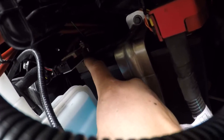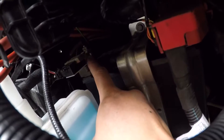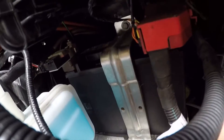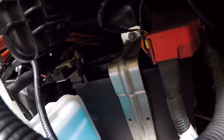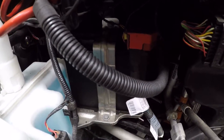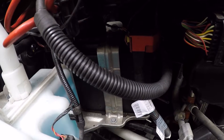The two terminals — negative on the left, positive on the driver's side — look fairly big but it's actually just a 10 millimeter bolt on top. You'll see it once you make some room and take the battery out. You'll also need torx bits to remove the actual terminal piece, which is where the top clamps mount onto — you need to move that terminal to the new battery.